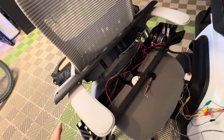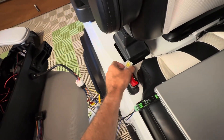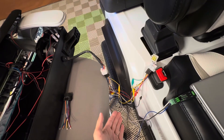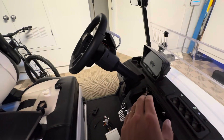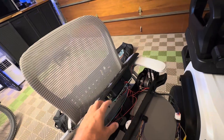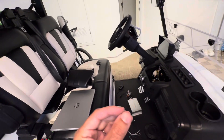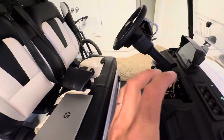I ended up cracking this soundbar open because I really wanted to be confident on the wiring diagrams I've been breaking down. Here's a sample of the pigtail that goes up to the soundbar — I've spliced into it with a range of alligator connectors, also allowing me to read the serial communication going back and forth between the head unit. The head unit lets you specify volume up and volume down, and that is communicated on serial across to the soundbar, as well as the soundbar LED colors. When I'm choosing red, blue, or green, those are being communicated by serial. So if we're going to do a replacement, a lot of people really like being able to change the color of their LEDs — could we incorporate that stock system into other LEDs on the cart, or could we even maintain it? That's something I'm also exploring.